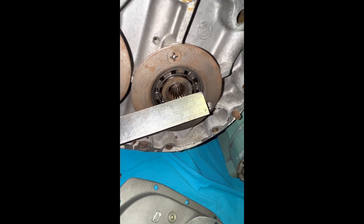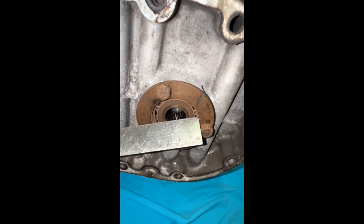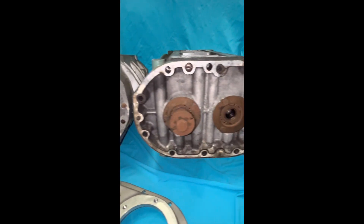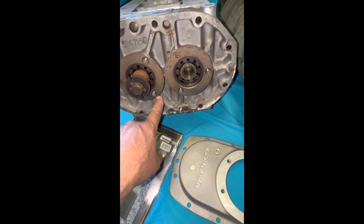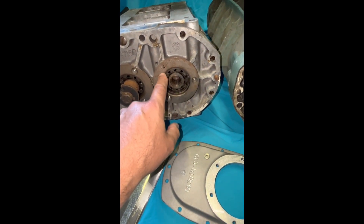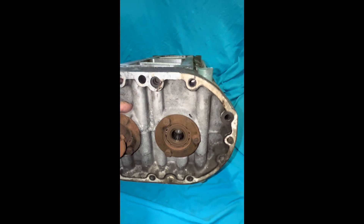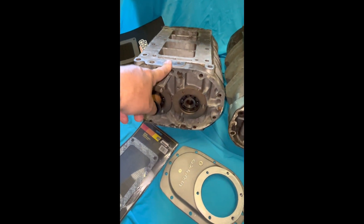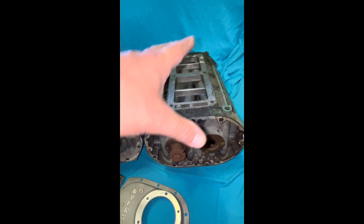These V92 bearings are almost two and a quarter inches in diameter, where the standard V71 series bearings are only inch and three quarter in diameter. You can physically see it — big bearing end plate versus small bearing end plate. Also, the V92 series end plates have extra ribs attached to the bearing housing compared to the standard V71 series, which practically has no ribs. A lot of guys grab these big-bearing, webbed, thicker end plates and use them on the V71 series cases.